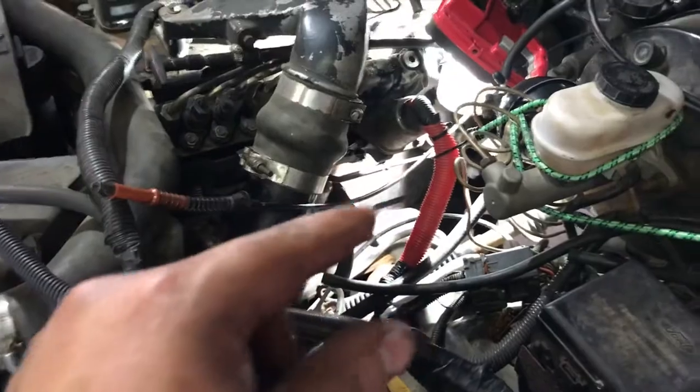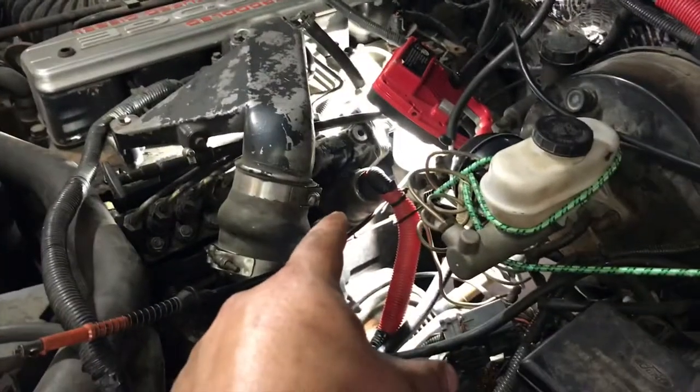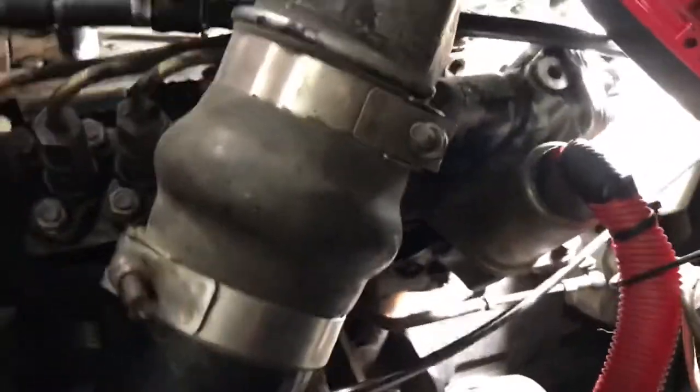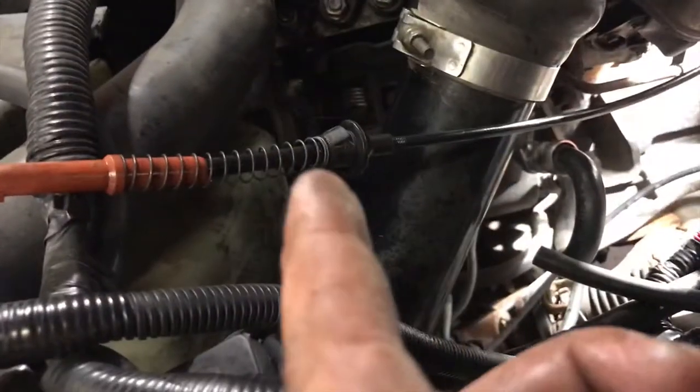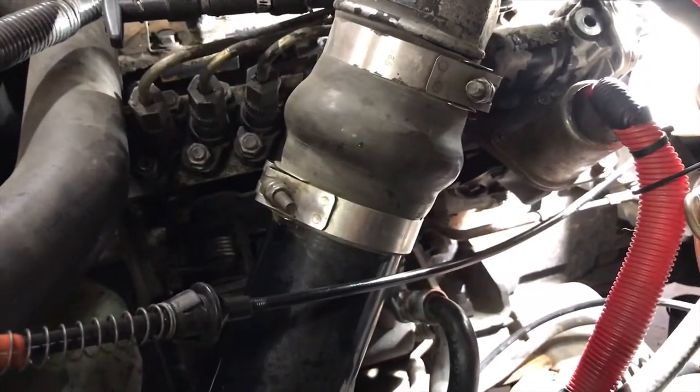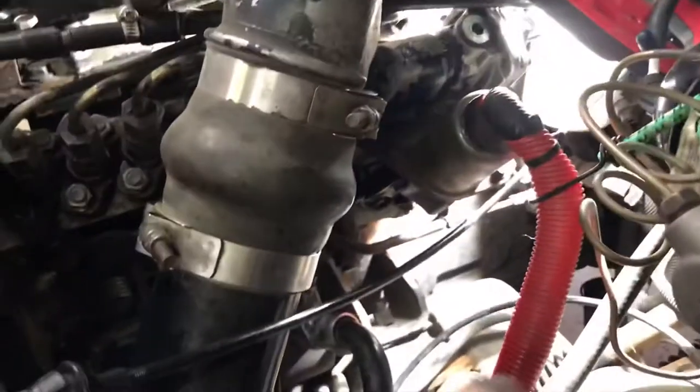Now we've got to address the problem with the fuel coming off, and I think it could be something to do with the solenoid. I'm going to do some research into whether this linkage is supposed to be this tight and whether the solenoid is supposed to get that hot when running. For now we'll put this together, put the preload spring on, and see if she idles. Then I'll adjust the idle — it's just a 10mm bolt tucked way back in there. Like a carburetor, you just adjust it up or down and there's a physical stop for the idle.